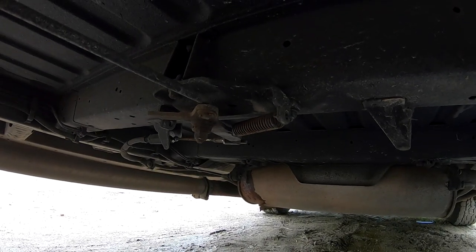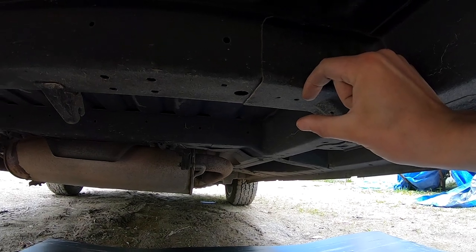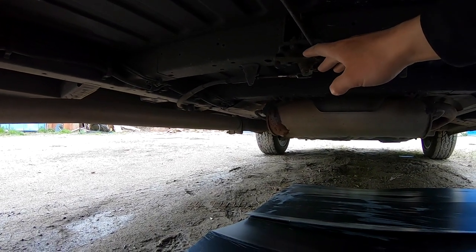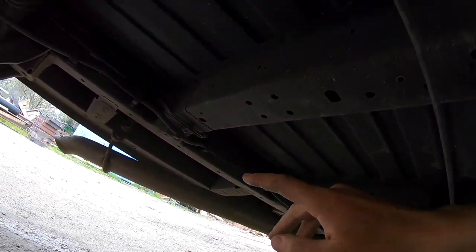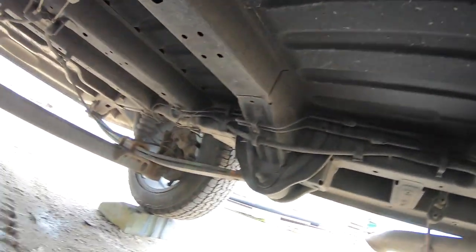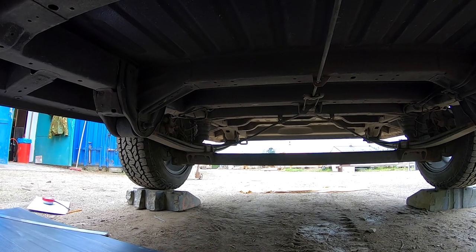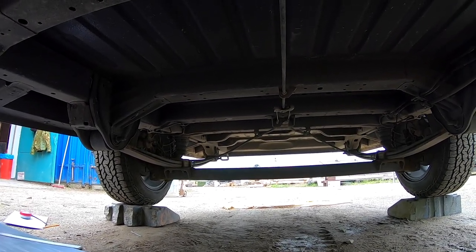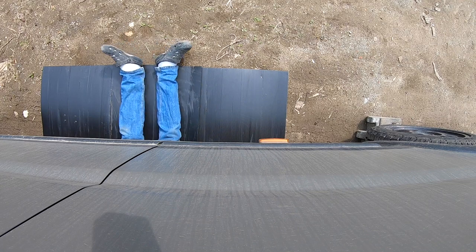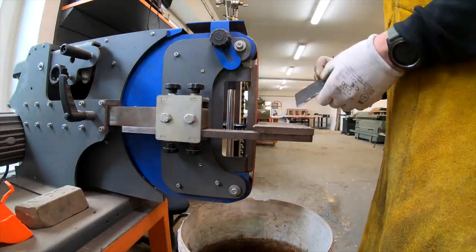I don't need to be cutting anything mechanical on the car because I'm creating 3 centimeter blocks on all the sides, supporting essentially everywhere to compensate for all of this, so the handbrake can be moving back and forth. I'll be able to unscrew the water tank from 4 points, 4 bolts, and take it down anytime independently. It's serviceable, it's replaceable, and if I need to do any mechanical work with the handbrake, I always have pretty easy access.